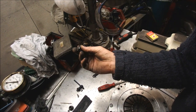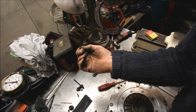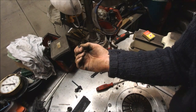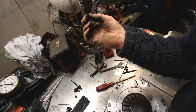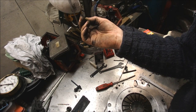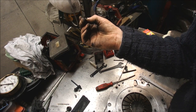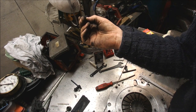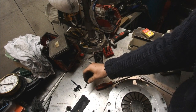So it looks like that's the process. If I'm really careful, I can get it that accurate again, where I've centre punched that by eye, and then drilled straight down with a drill which is only, I don't know, 5 thou on each side, smaller. So yeah, 4 more to do. I'll come back when I've done that.